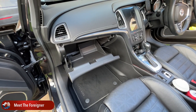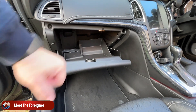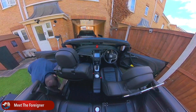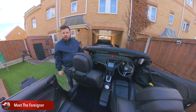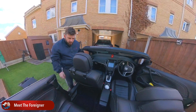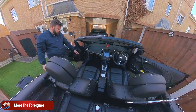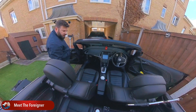To be able to do that, we're going to go through a grommet in the firewall, which is located behind the glove box, so we're going to unscrew these screws and remove this. I've seen some tutorials saying to remove the seats. I don't think I'm going to remove them. I think I can work around. This plastic trim can be used to route the wires through those channels, but I think I'm going to route them through the middle console.